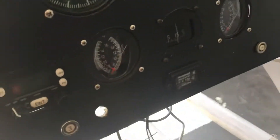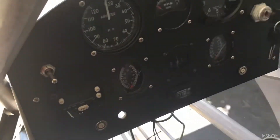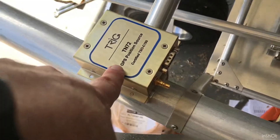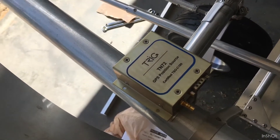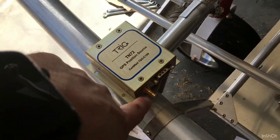Here's what I got for the ADS-B bundle — because I'm underneath the Mode C veil of Hartsfield, I'm within 30 miles of the airport. What I'm going to do is run the controller down to this GPS source right here. This is the Trig TN72. This bundle was pretty cheap — it's not for certified aircraft, but obviously I'm building experimental so I don't need that. This is your GPS source, and it's going to have a coaxial cable with a QMA connector. I'm going to build these D connectors and do the pins on this one.